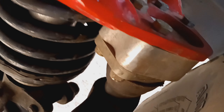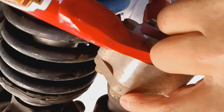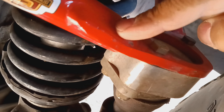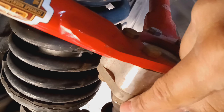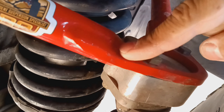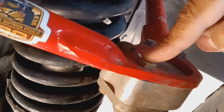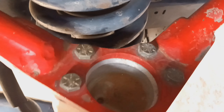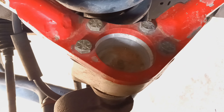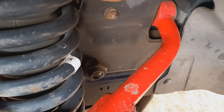Let me show you that - all the way through, all the way down to the bottom. These are the original lock nuts that came with the JBA upper control arm, as you can see - JBA lock nuts. So these are the only aftermarket bolts, grade 8. Can't stress it enough. You don't need grade 8 I'm sure, but grade 8 is what I used because I am running a spacer. So, grade 8 bolts, 1-inch spacer, and the JBA upper control arm.